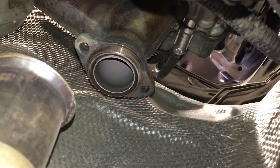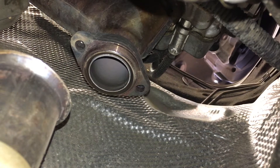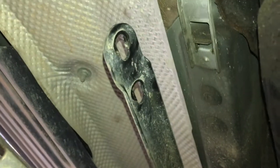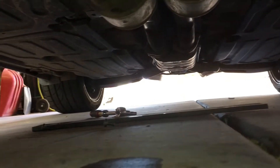As you can see right here — there's your exhaust flange. Those bolts came out without too much problem. It was a 13mm with a 12-inch extension on the socket to get those out. Maybe some PB Blaster because there's high temperature. There's also a bracket here that holds the exhaust — those were a 12mm. And then further back there's another bracket that holds the cats up, and those are a T45 Torx fitting.